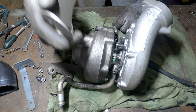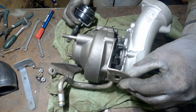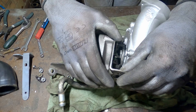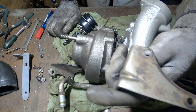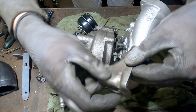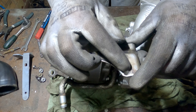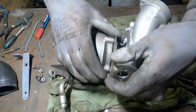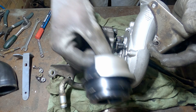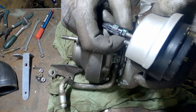Finally figured out how to mount this vacuum regulator to the turbo so it would fit under the bonnet and nothing would hit the engine. At first I tried one approach but it didn't fit quite well, so I took this part from my old turbo - it mounts to the hot side and fits the new turbo perfectly. I just needed to make a slightly bigger hole so it could fit a bit further from the turbo, and everything fits perfectly. The regulator is in just the right space and fits in the engine perfectly.